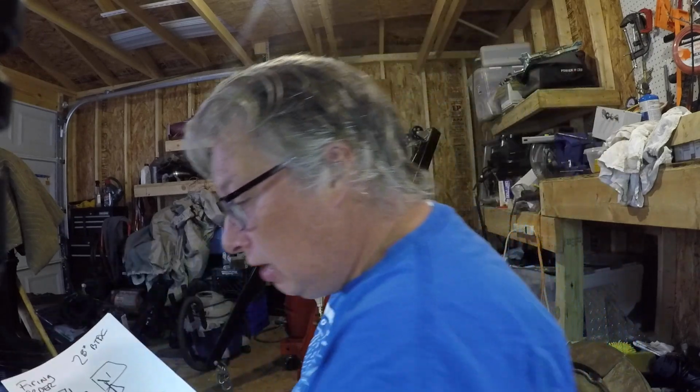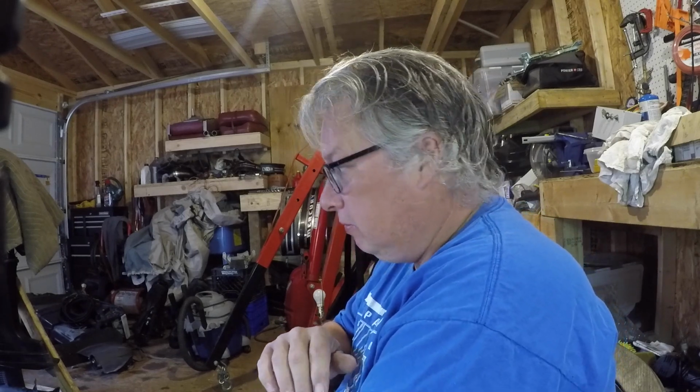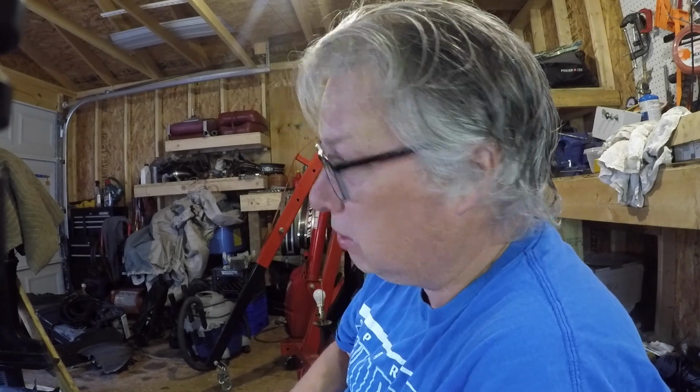The guy picked it up. He thought the idle was a little high, and so I dropped it some more. I took one more turn, and once I had it to that point, one turn was probably plenty. It probably dropped it a couple hundred RPMs. So that one shipped, and it's in good shape. It was an old motor. I thought it was mid 80s, and then once I researched, it was a 78, and it was bad. The needle float keepers, the little keeper pin on the needle floats, were not in either one of those carburetors. And there were lots of wiring problems.